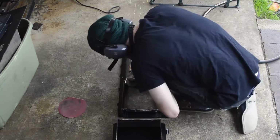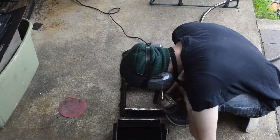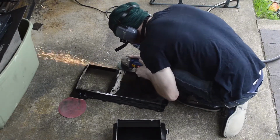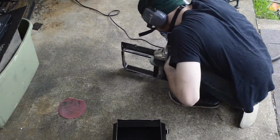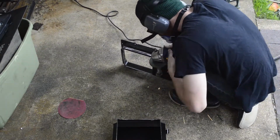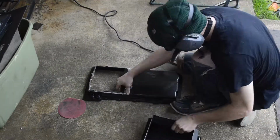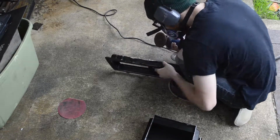But on the 4T80E, the valve body is so much bigger, I couldn't even modify it to put the starter there because it gets in the way of mounting it. On the North Star, they put the starter in the valley since there's no camshaft there because they're overhead cam motors. But on the LS motors, they got the camshaft in the center. So pretty much the only place to mount it is on the bottom where the oil sump is usually at.